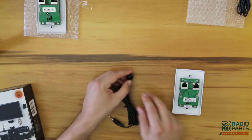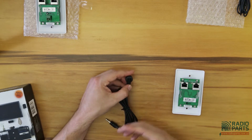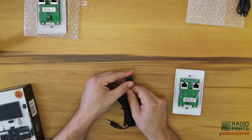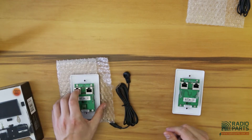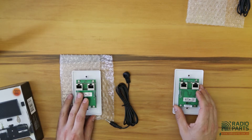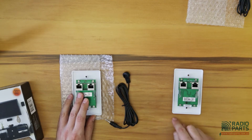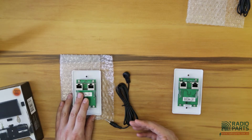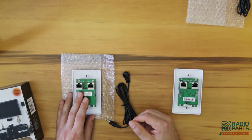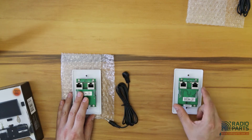Whenever you've got these HDMI-over-two-Cat5 setups, our preferred solution is always HDBaseT because it's actually a higher bandwidth. This one is 2.25 Gbps, which is a typical bandwidth for these cheaper sender-receiver units. Having said that, the Foxtel looked exactly the same as when I ran a direct HDMI — the bandwidth demands of Foxtel are not that high. The manual specifies it's up to HDMI standard 1.3a and won't support things like deep colour, so it's not going to be your ultimate solution. If you can, maybe get an HDBaseT solution like a Blue Stream, Quartz, or Firestorm.